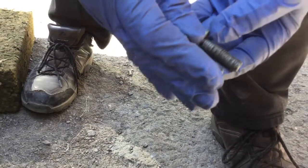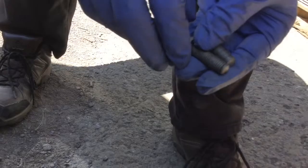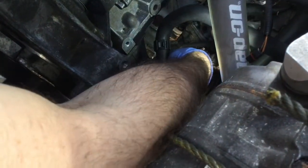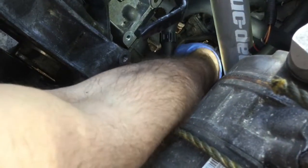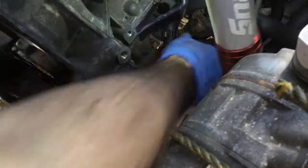The bolt heads are Torx, so I'll start with those. The one on the side is a slotted bracket — that's what locates the power steering pump. The third bolt is the same size and type and goes right here. I'll just start to boot them in place. Now all three are in, but I need to torque the two up front first before it's fully located.